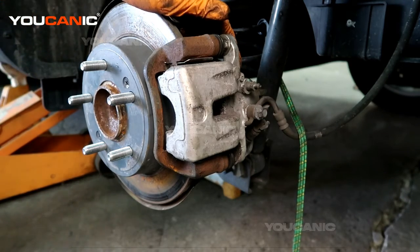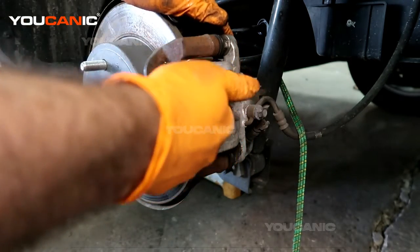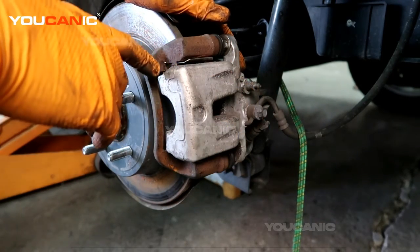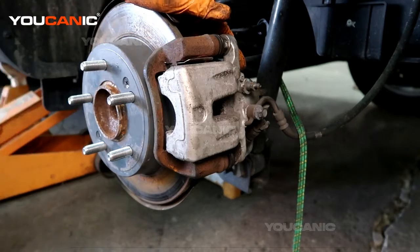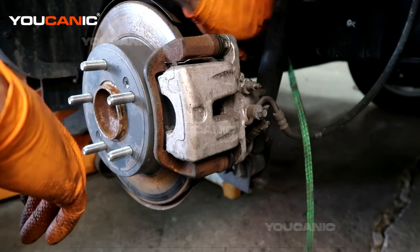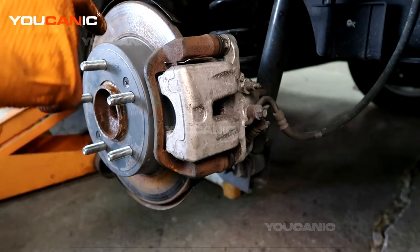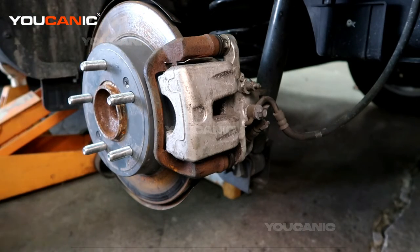You're going to want to pump your brakes and watch that caliper that it spins and it hits that one tab on the back of the brake pad there and locks that into place. And then you would put your tire back on, snug it up, drop it down, set the torque on the lug bolts, and you'd be good to go.